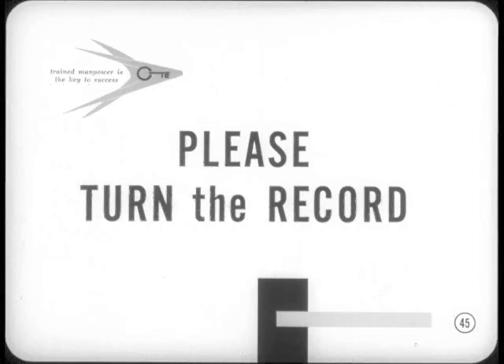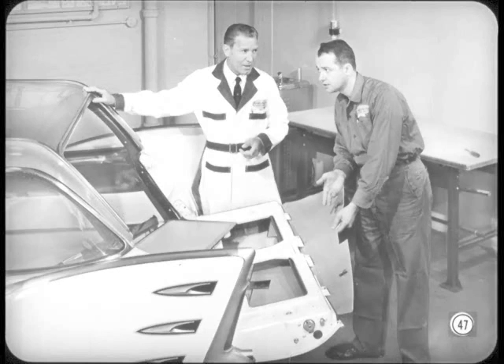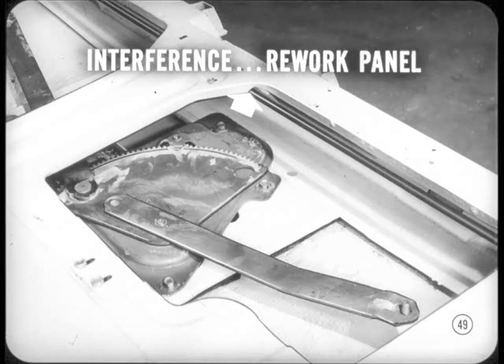Now hold on — let's talk about service on tailgate locks. Suppose you get a case where the tailgate latch doesn't work right. That can happen if there's a maladjustment, interference with the linkage, or a remote control rod that slips out of the latch assembly. In any case, you'll have to remove the tailgate cover panel, the garnish molding, and the paper water shield. Discard that water shield — you're going to put on a new gasket and drill those drain holes. Take the glass assembly out too so you can get at the locks. Look first for some sign of interference between the remote control rod and inner panel.